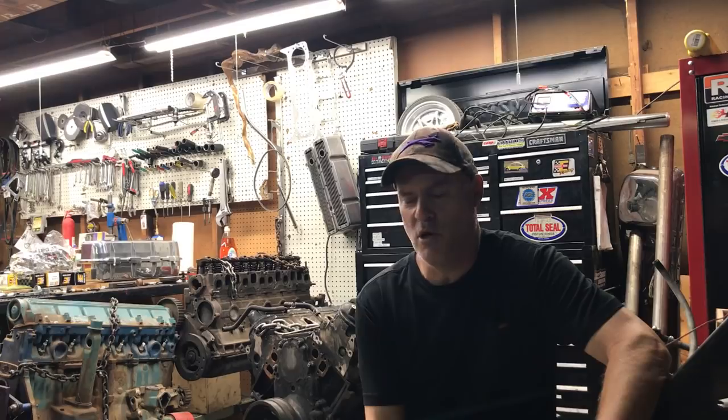One of the things we've noticed is that most street rods we build with any kind of boost or compression, they're usually on the verge of overheating all the time — you've got to have a massive cooling system. The aluminum LS-based engines, I've personally noticed a 30-degree temperature differential. They run 20 to 30 degrees cooler than the earlier cast iron blocks. You build a real hot-rod early cast iron small block and sometimes you're on the verge of overheating half the time in traffic. That problem's been solved with the aluminum engines.